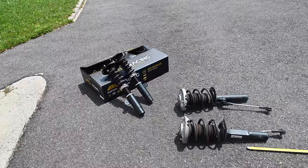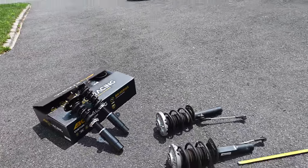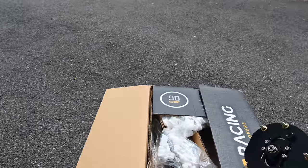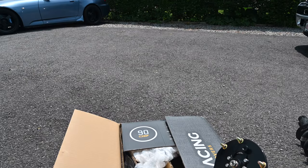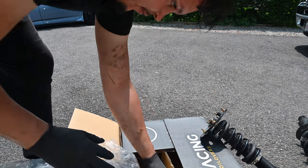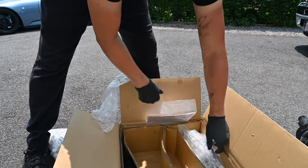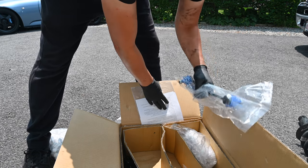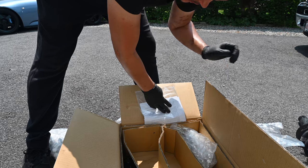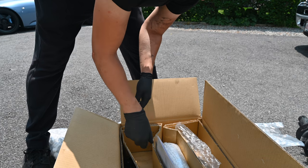I've got the front new BCs already set up to how I want the car dropped - about two inches off from the original height. That should close up the wheel gap nicely. I've got them measured and separated left to right. In the box we also have the rears, but waiting for Amazon to drop off the external Torx sockets for that - those should be here sometime during the day. The kit also comes with shorter end links for the front stabilizer links, the keys, and the adapters for the dampening on the front.